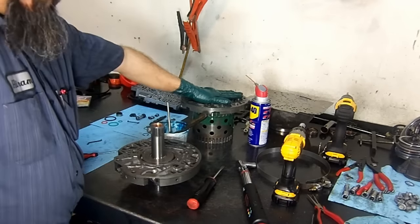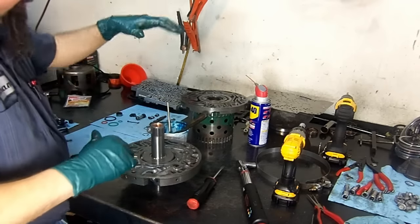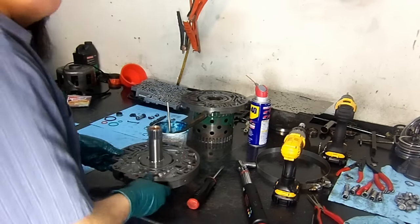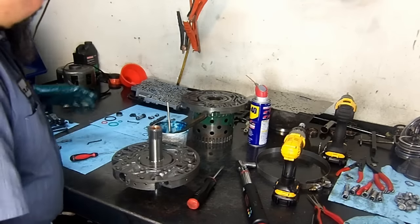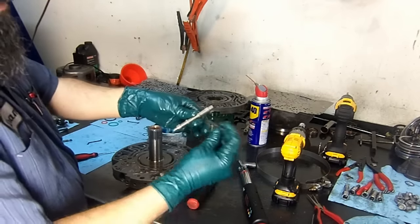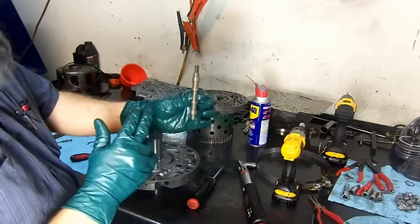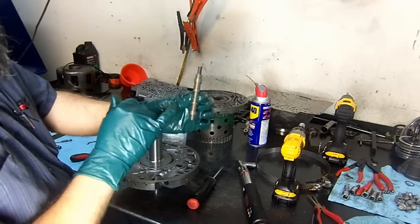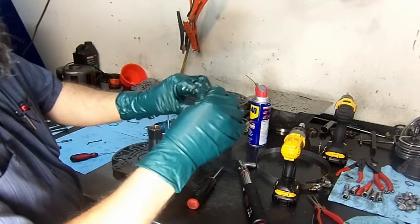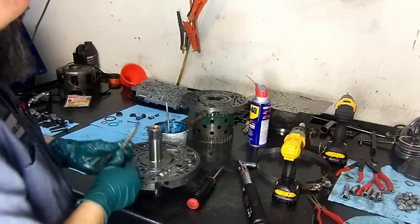That's our pump body where the pump rotor goes. And this is actually our pump cover. The pump body goes to the outside of the transmission, and the pump cover goes towards the inside of the transmission. Okay, so now we're going to install our torque converter clutch apply valve and our spring. This is a little different from the earlier models. On the earlier models, the valve looked a little different, and you had two ends that looked alike, and you had two springs, double springs. This valve changed, it now has a pocket, and the spring goes inside the pocket.